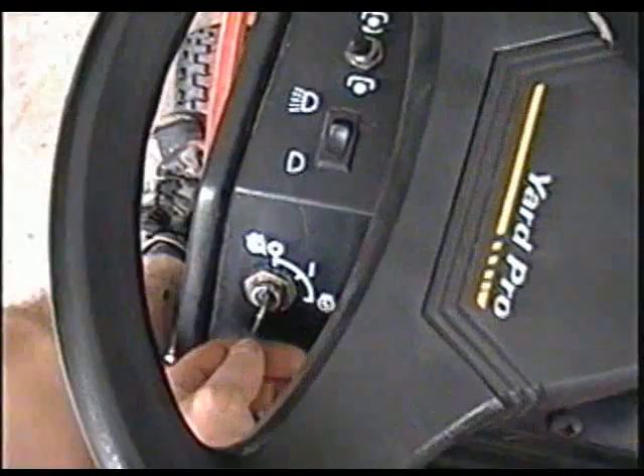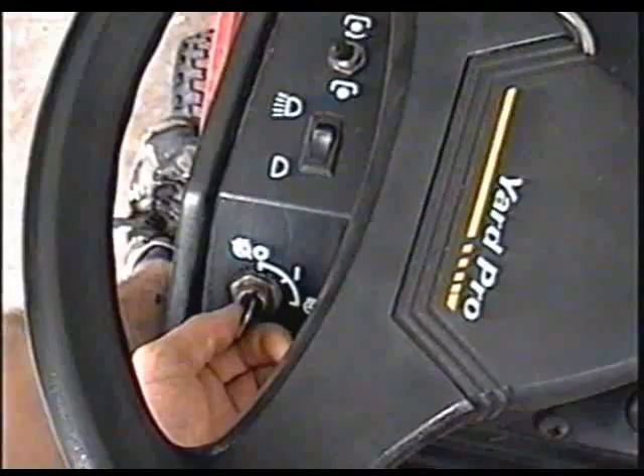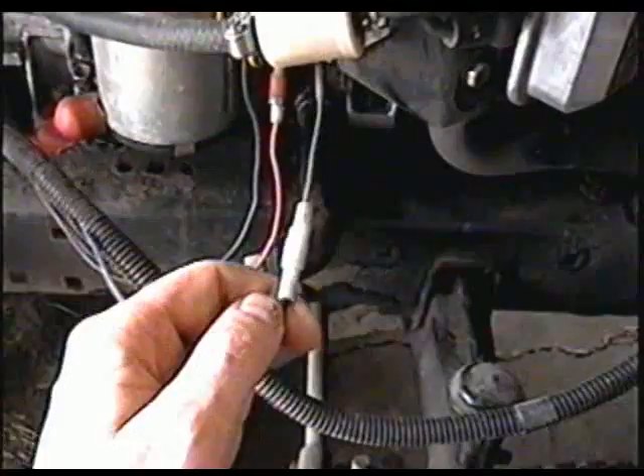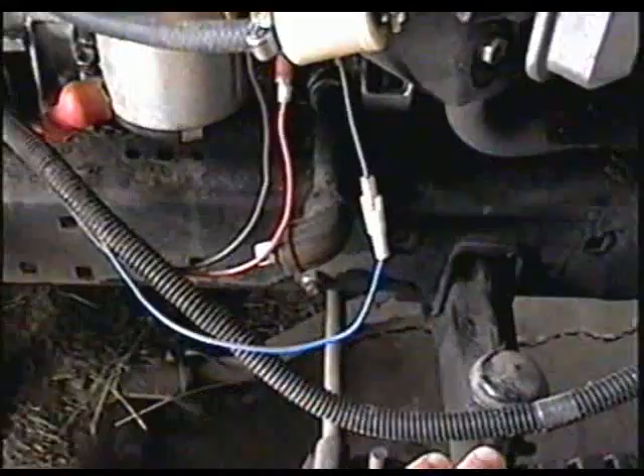It's running with the key off. You turn it and it goes on two solenoids. Then eventually it'll stop when it feels like to, but sometimes it won't stop at all, so that's a bit of a danger there. This wire here goes to the solenoid on the carburetor, which shuts a valve off when you turn the key off — so this works. What happens is the engine keeps burning the fuel that's left in the carb, and sometimes it shuts itself off just because it ran out of fuel from that little valve going off.